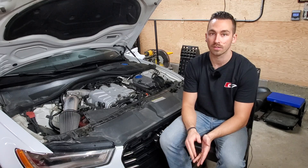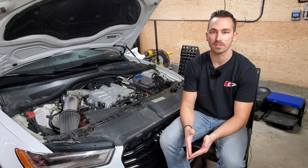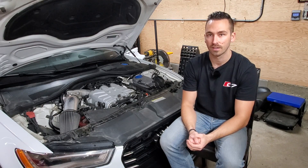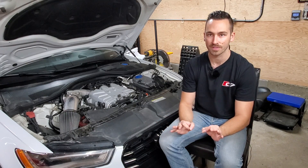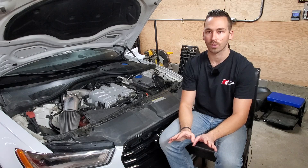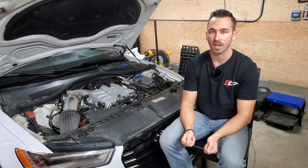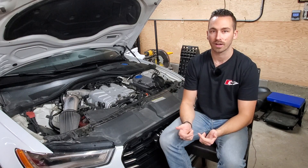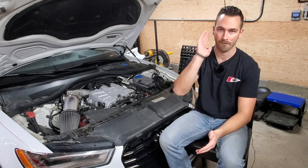This is what myself and my friend Shane Horning — the World Record A6 — found. We had to start using the upswing method. Upswing means that instead of seeing the RPM settle at around 2800 RPM, you'll be as hard as you can on the brake and floor the gas pedal — this all happens very quickly. As that tach needle comes screaming up, you have to time it so that when the needle passes about 2400 RPM, your foot pops off the brake. By the time of your reaction time, the transmission starts rotating and the tires start moving, you should have landed around 3000 RPM. If done right, you won't have spun, over-revved, or bogged — and you'll be flying.